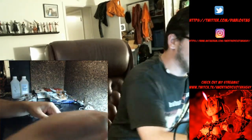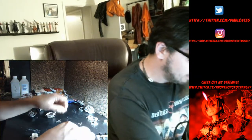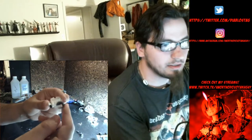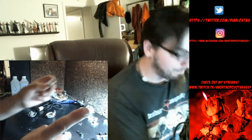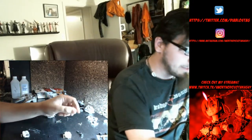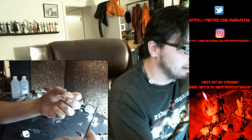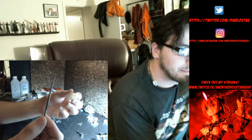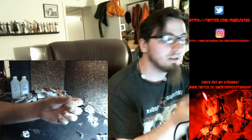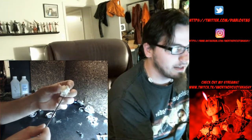So toss the old gear set to the side. Don't need those anymore. So we need to reuse these little gears that spin. But before we transfer them, this is where one of the files comes into play. Everything on here, on these, is a little bit casted over just a tad. So the gears won't spin perfectly. So what I do is I take it, it's kind of like a square file. It's a precision square file, long. You could probably get away with a rounded one, but I'll put it in and I'll just spin it around